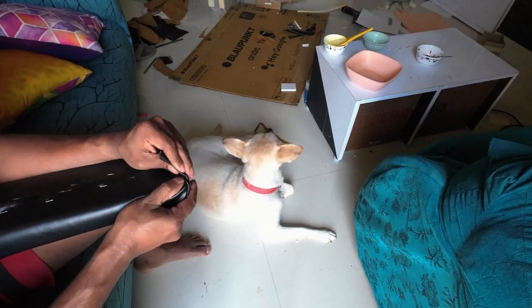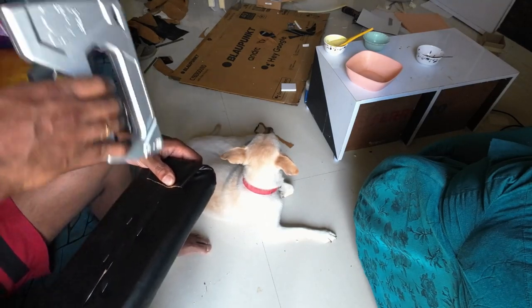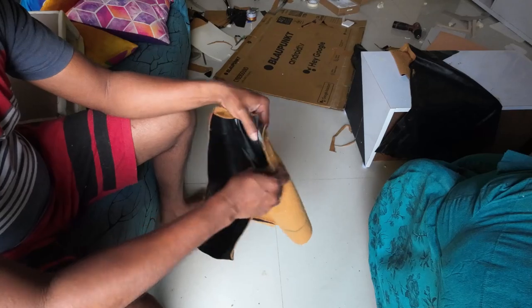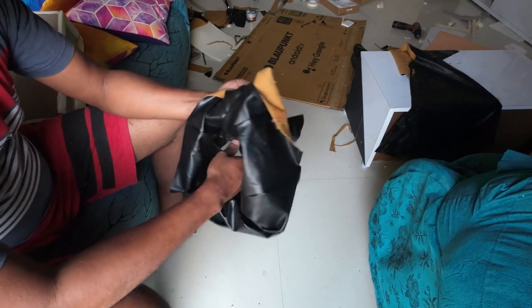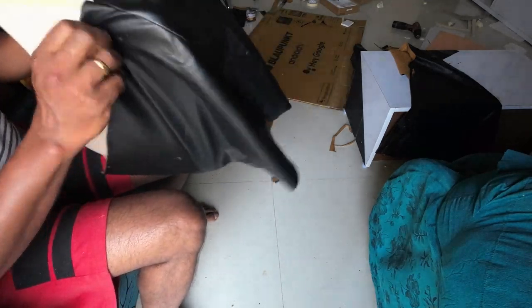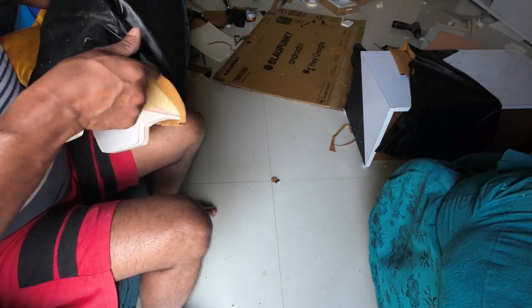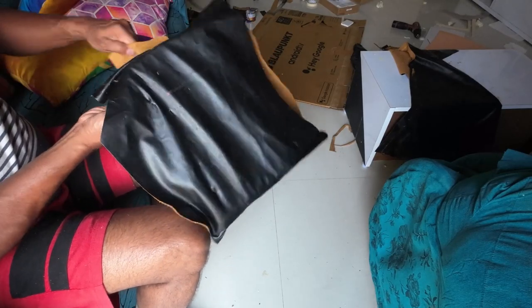The front and back ends are nicely folded and tightly stapled to the base plate. If you don't have heavy duty staples, you can use normal staples or contact glue. Our next task is to stitch the wrapping for the side plates. It is a tricky process — we need to stitch the parts a bit shorter in size, because the PU leather has some elastic properties and will look nice once inserted into the product. A slit is made along the front side for the handbrake housing and is nicely folded and stapled to the inner edges.